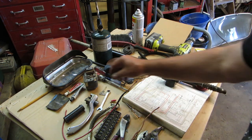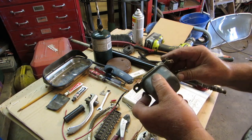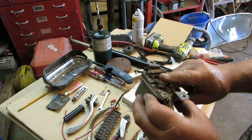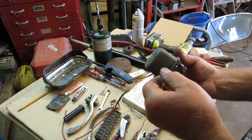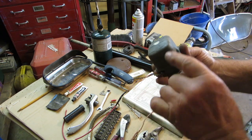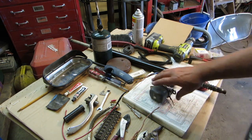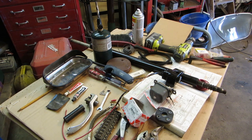Next thing we're going to do is I examined our voltage regulator, and I was careful to put it in a place where this wouldn't get broken or ruptured in any way, and so everything's fine. And Abner had cut this wire off, or the rats had chewed it off, I don't know. But we'll have to splice that from our wiring harness inside. So the next thing we'll do is we'll put this on, we'll splice that wire, and we'll hang our steering column, and then probably put our connection to the front end, and put our new German-made steering coupler in.